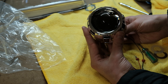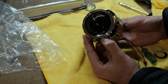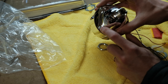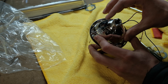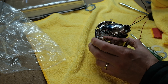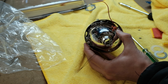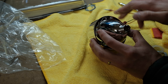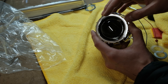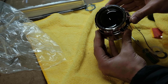Before we install the projector into the headlight housing, in our case we'll want to install the shroud first, because these shrouds actually mount to the projector itself. I was able to recycle the screws from the old bulb holder to mount our shroud on here. If you order different shrouds or go a different route, you might have to glue the shroud to the projector, so that'll just depend on what way you end up going.